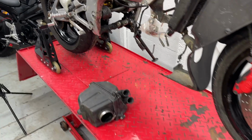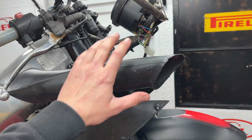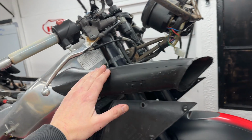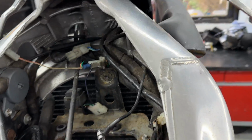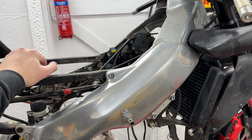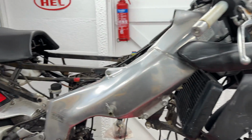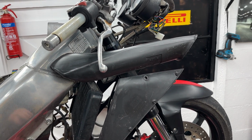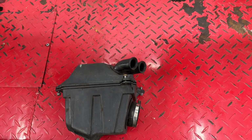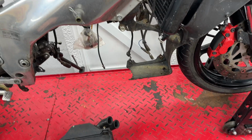So whilst we're in the middle of taking everything apart, something I'd like to run past the RS125 experts. We've got this intake on the nose cone fairing, which brings cool air, as we've seen there, and then just dumps it onto the top of the cylinder head, which for me doesn't seem like an optimum way of using that, in all honesty, because especially in the car world, and even things like the Gixxer, the R1, they all have these intakes on the nose which feed the airbox with cool air. Obviously having carburetor versus injection, I guess you could run it lean if you plumb that directly to the top of the airbox. So there is a modification you can do to this with spinning around the rubber so it gives a Venturi effect, which we're going to do.